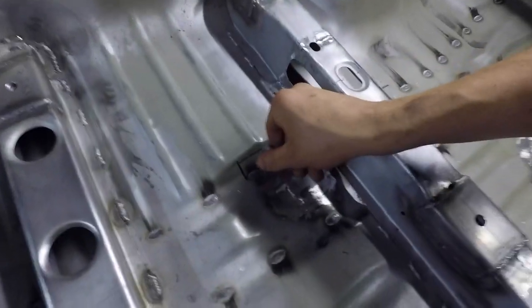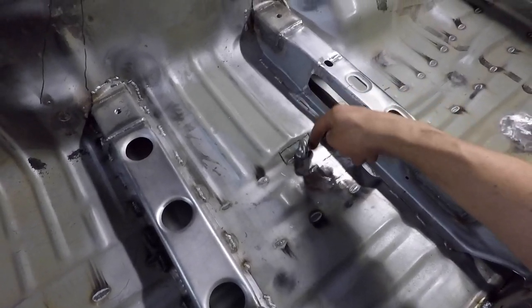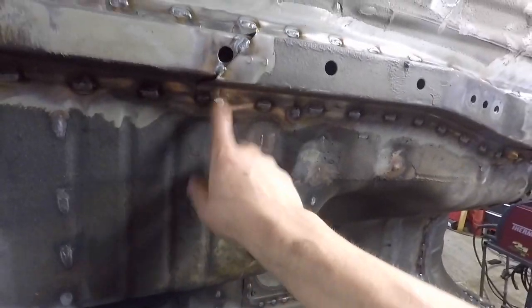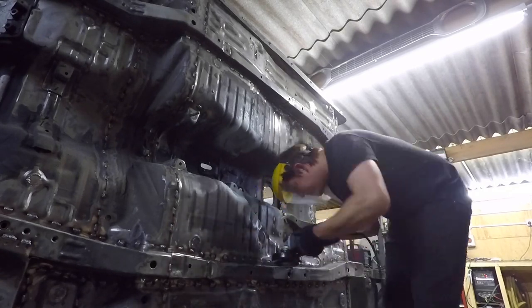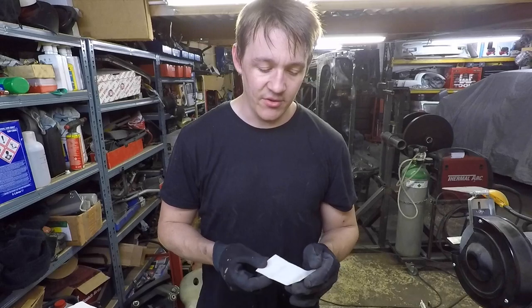Done the other side. I'm just trying to figure out the best way to do the crotch strap. It's useful it being on this jig. The reason it's going to go 5-point harness instead of 6-point is because this is where the chassis rail goes. If I have one exactly in the centre of where the seat is, I can just about get a plate. It's been a bit annoying because it was on kind of a contour - you can't really get it to sit flat. So I've encouraged that with a little metalworking hammer. It's like modifications rather than just filling holes up.